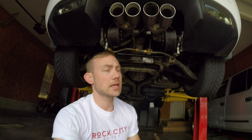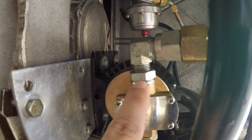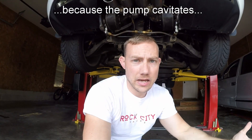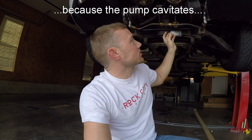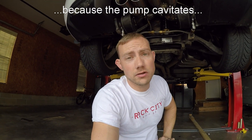One key thing is these fittings right here — you have to have this washer and a compression washer, you have to use Viton seals for both of them, and it has to remain airtight. If those seals go bad or it's not airtight, it just sucks air in through those fittings and you don't get nearly as much flow.